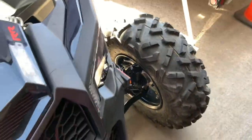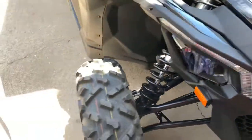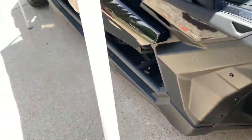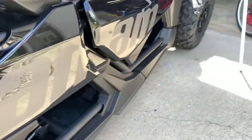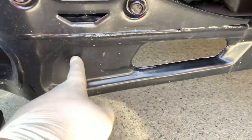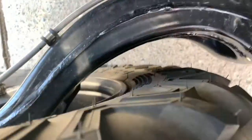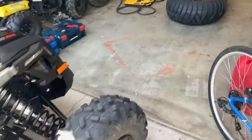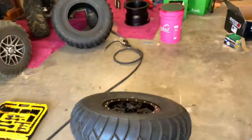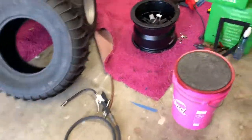The bonus to only having 14-inch wheels is that it's a lot lighter — when you're talking about speed, you definitely want lighter wheels. But I think it's a design flaw in the Can-Am. What ends up happening is you kick rocks up and they bounce along the car, hit your trailing arm, and there's a huge scoop right here that goes right in and drops them in your wheels. You can actually see my wheel has some scrapes on it down there from the rocks. That's why you want to put 15s on your Can-Am. If you're a KRX guy, your mud scrapers can get rocks stuck in there, so be careful.